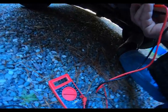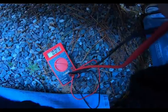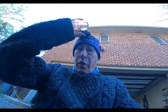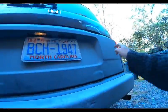Nothing. Okay, nothing there. Now again, power to your turn signal, brake light, power to your turn signal, brake light again. Aha, what does that tell me? Well, it tells me that I probably have an issue in a 15-year-old plug. It may be the wire and harness that goes from here to there. So I know which wire, which plug it is that's probably compromised.